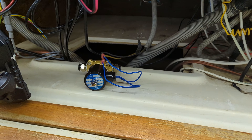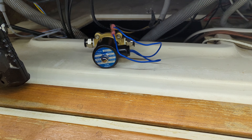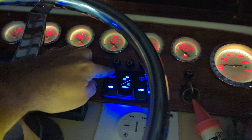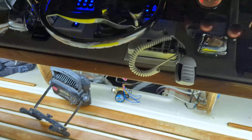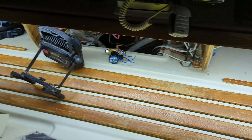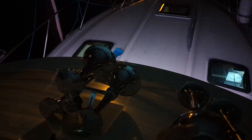I just did the wiring for the solenoid. So when you hit the horn switch, that will let the air go to the horns using the original switch. The air line I had bought was way too stiff and would not bend at all. Old horns, new — should be ridiculous.